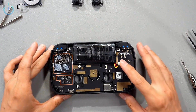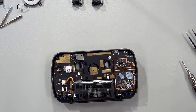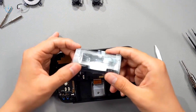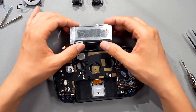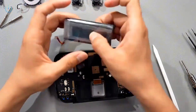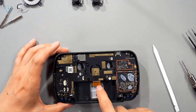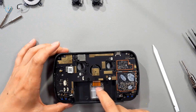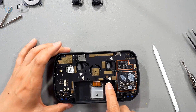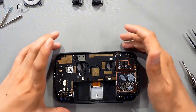There's really nothing else left to remove here. Then it's the battery — pry it off. We've taken it out. There's a thin little metal contact and a small plastic plate underneath it. Removing this battery is actually pretty easy; it's only held in place by adhesive on both sides. We can see that this is the display cable — it comes through here and its connector is clipped underneath. Over here there's another cable; I'm not sure what it's for, maybe for the vibrator. We can leave that for now and focus on removing the motherboard first.